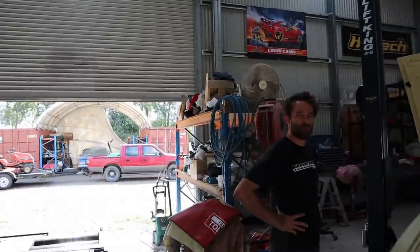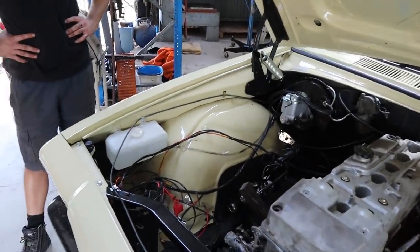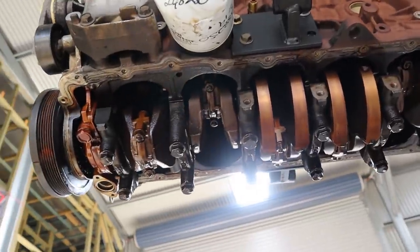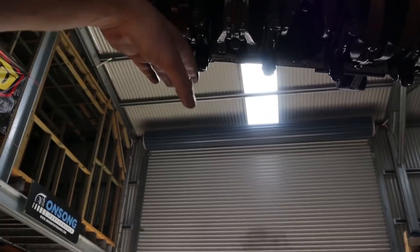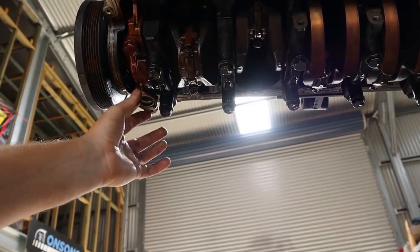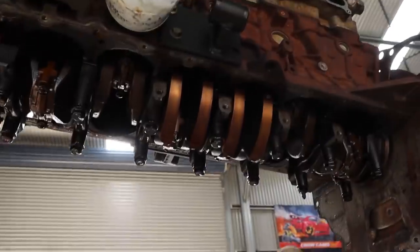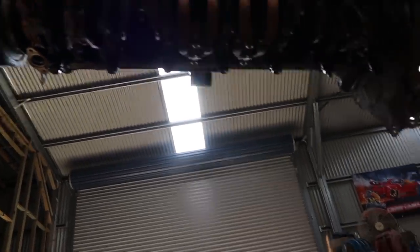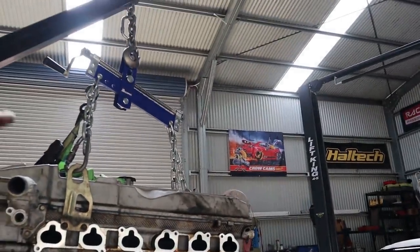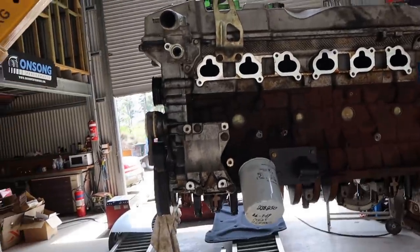A body lift sounds silly but it's about the only option we've got at the moment. They are legal in four-wheel drives, but it would just be dumb. So we're doing some measuring up about the possibility of fabricating the front of the sump completely flat — as close to the main bolts as we can have it — and then running a pickup from the pickup point with the pump externally, running it back into the back of the sump and down into the pickup point. We're working out whether that combined with getting the bracing out of the underside of the bonnet skin would be enough clearance to shut the bonnet.